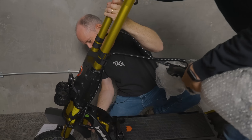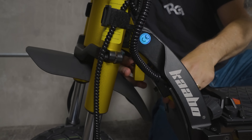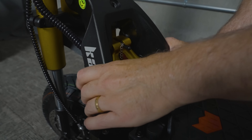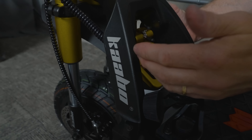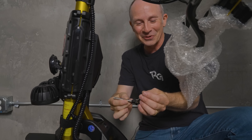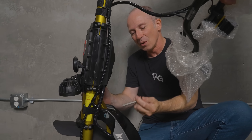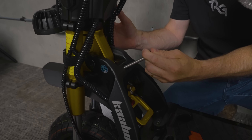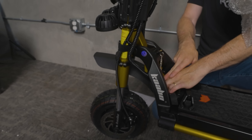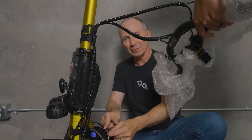The latch hasn't changed — it's a little bit complicated. You feed this bolt through right here and it drops down, then you push the latch back down. The first time you do it, it's really not that intuitive, but once you've got it, you've got it. This chain just came off — something we've been calling out since these were new. This pin right here is your security pin. Even if the latch comes undone while riding, this pin will keep the front end from folding on you accidentally. Never ride without this in place.